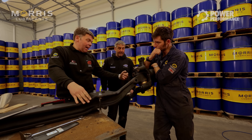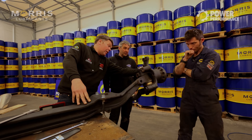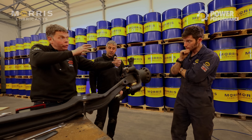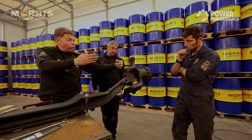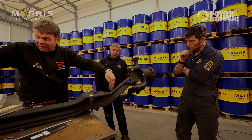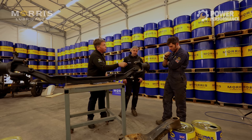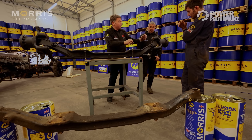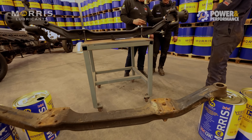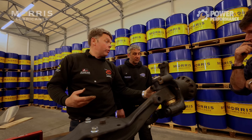What we had to be really careful of — we set off with a centre point up the middle of the kingpin. So everything that we've done to it, we've bent the axle back so the centre point has ended up back relative to the middle of the axle — it's still where it started from, even though it's been twisted. It's still in the face to rotate it forward slightly. And then once we'd done all that, we put three degrees of negative in it, because that's what the rules will now allow us to have.